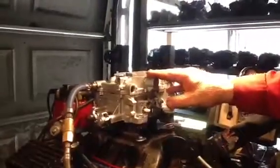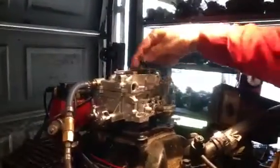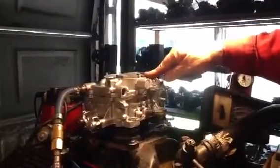At 3000 RPM, the carburetor runs by itself. It's a 400 CFM, got a four-and-a-half inch diameter top. You can get a fitting that'll turn it into a five-inch top — that's what they use now — or you can leave it at four and a half, that's what they used to be.